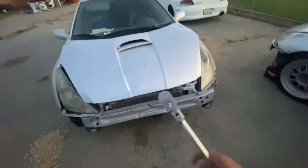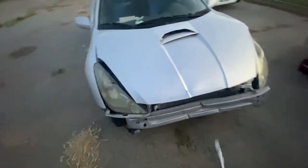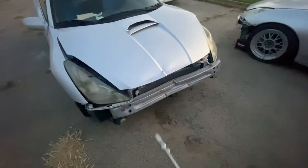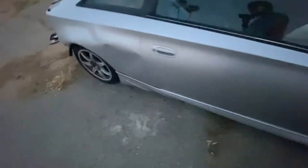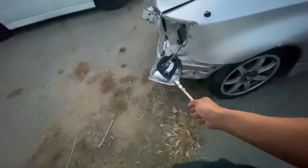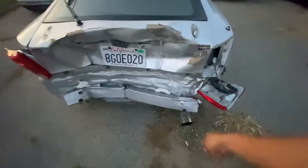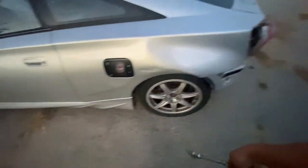So, time to check out if this motor is any good and the tranny's good. So, let's take off the hood, take off the radiator support, and put a temporary radiator so I could drive it and fix the tail lights. Just probably gonna zip tie it somewhere. Now I have lights, I still have plates until the end of the month, so same thing with those tail lights. Just to go for a test drive and then do a compression test on it later.